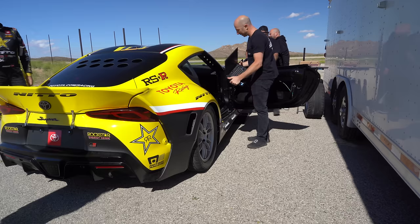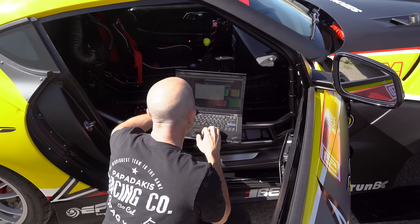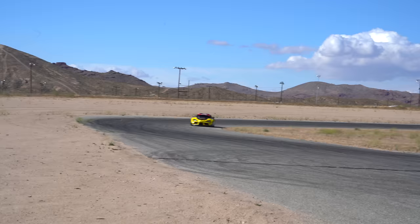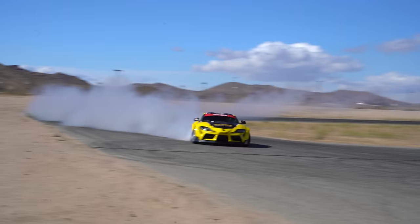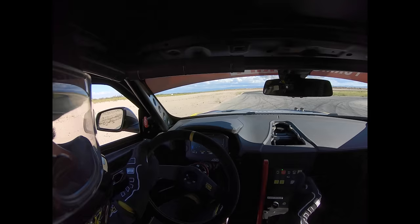The AEM Infinity system that runs the engine has a full data logger, so I can download with the laptop all of the data from the test session and look at it — make sure the temperatures are okay, oil pressure, all the different systems in the engine are working okay before we go out for another run. For the next laps Freddy was going to get on it harder and actually start drifting — starting with really mild drifts at low angle, then going progressively harder and bigger and longer. What he's testing is how the car feels at big angle — specifically that it counter-steers well and has good steering feedback for the driver.